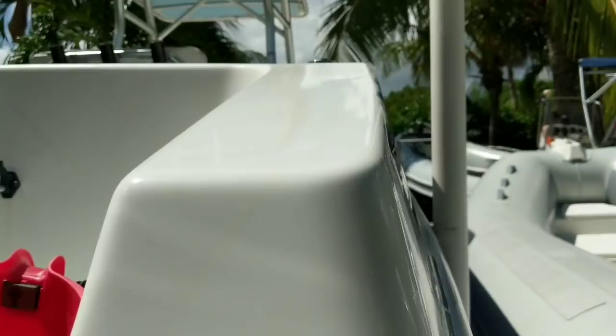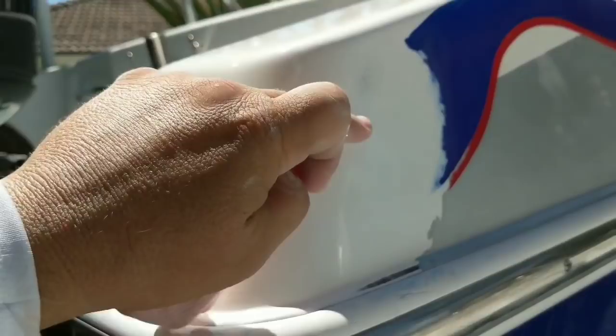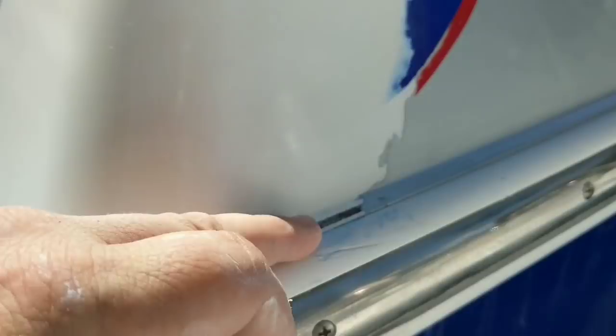Okay, just to be legit, and I do want to show you guys that if there's less gel coat, I don't know if it translates right there. You see that right there? That is a risk that you can have. So obviously right here there's more gel coat than there is here because I did the same process and same procedure. The difference is there wasn't enough gel coat and it's already going to the glass, okay? Like here, this is an area where it's expected to be less also, okay? So, I mean, after the fact, I'm gonna have to figure that out and fix that.